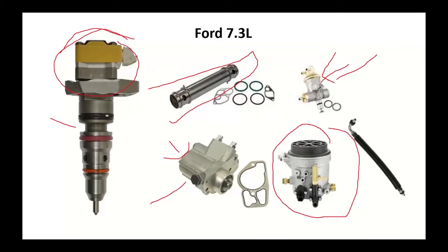We saw a lot of guys would order new injectors, put the injectors in, and then do an injector test, an electric injector test on the engine with no oil in these things, and it would wipe the injectors out. So you just put 8 injectors in, and you're sending 8 injectors back because the thing won't start now. Never do that injector balance test. That is the technical term Ford used, the buzz test. Never do that unless the engine has been running so that you've got oil in here lubricating everything.